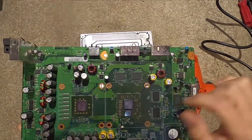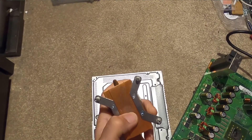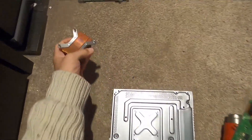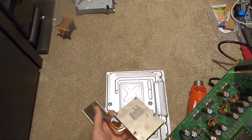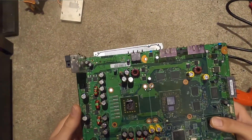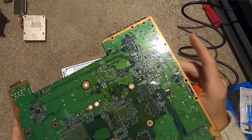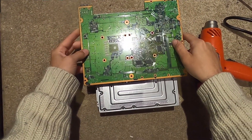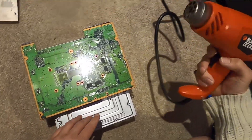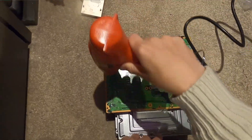We went over it a dozen times and also cleaned up the heat sinks. I don't know what compound they were using, but this is actually like baked on there - maybe the heat from the Xbox was so intense it baked a shadow onto the heat sinks. I spent probably an hour or two just cleaning these things. We got rid of all the extra dust, took off the heat pad. Starting from here, we're going to use the metal base plate to lay our board down and go on low heat setting with the heat gun, going over it for about a minute.